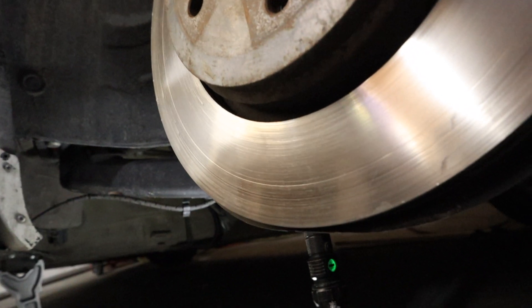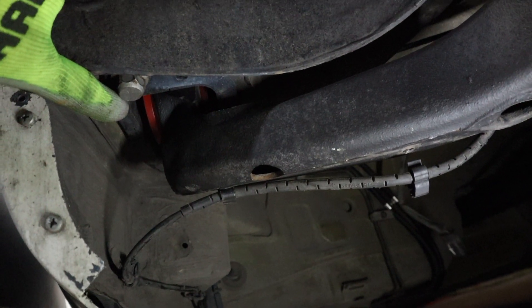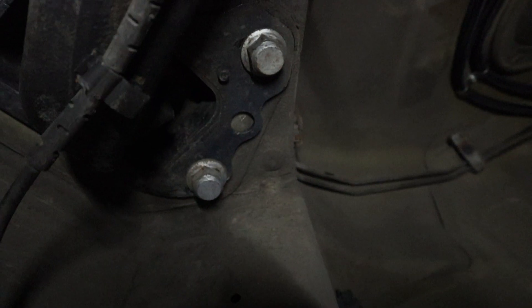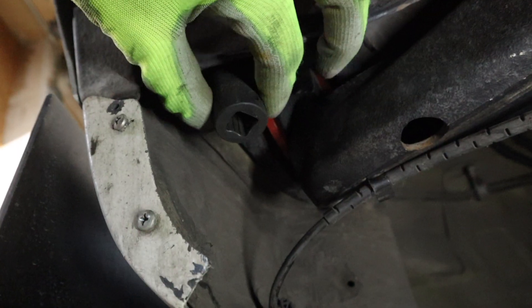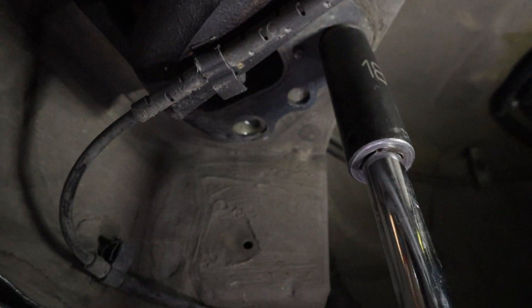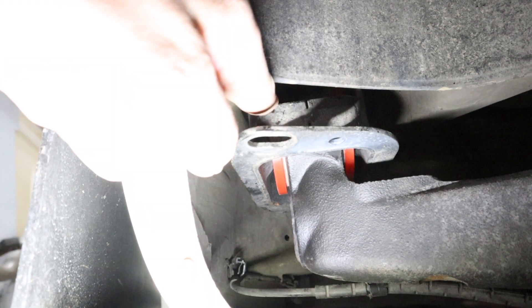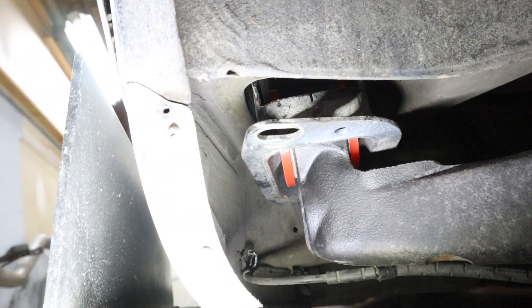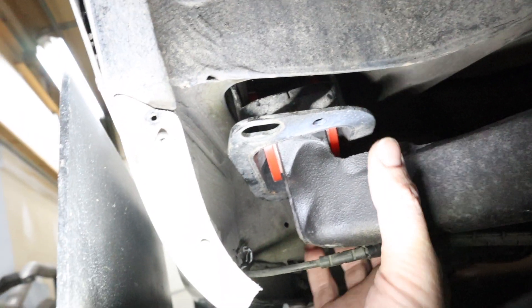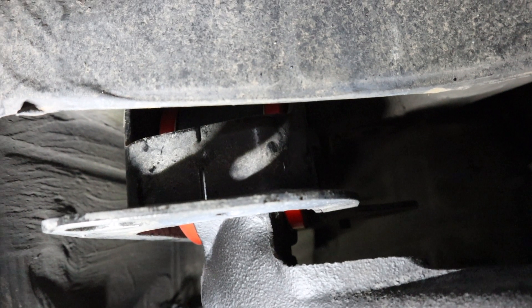After taking the back wheel off you can see here there is the new Bevansy bushing that we installed a few weeks ago. There is one of the bolts there and then there are two more — 18 millimeter — and these should come right out. Once it is down like this I'll get a pry bar underneath here and swing this down just enough to get that bolt out. The nut is just right here, but I'm going to need both hands to do this.